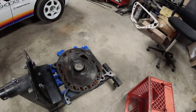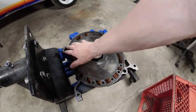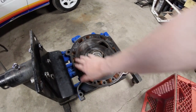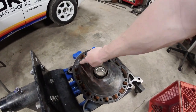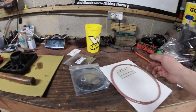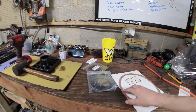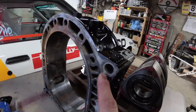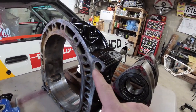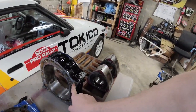I prefer to put the rotor on the iron next. This is your last chance to clean any of this stuff — make sure everything is clean. I'm going to put the rotor on first, then put the sealant in the coolant grooves using Permatex High Tack, put the coolant seals in, and then sit the housing on. Don't forget the O-ring that goes in the housing for the dowels — forgetting it causes oil leaks or low oil pressure and means tearing the whole engine back apart.